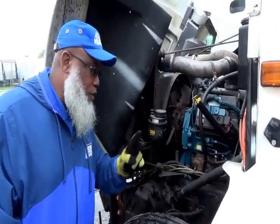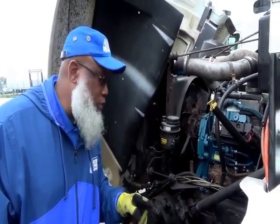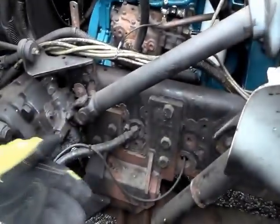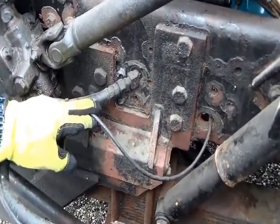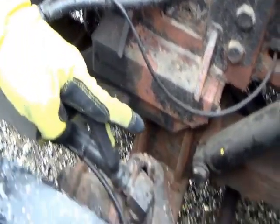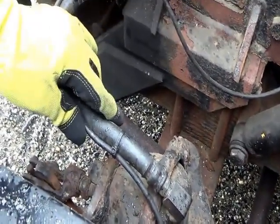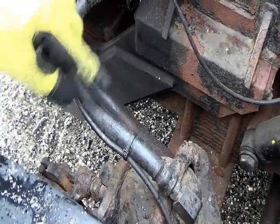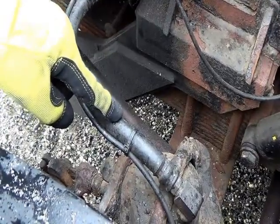So we mentioned system number 1, which was steering. Now we're going to system number 2. System number 2, you work from in to out. So you start with your ABS line and your brake hose. The brake hose, not cracked, not broken, and secure. And the ABS line, not cracked, not broken, and secure. It's rubber, so you say not dry rotted or frayed. And rubber hose, air is going through these holes, so you say no leaks.